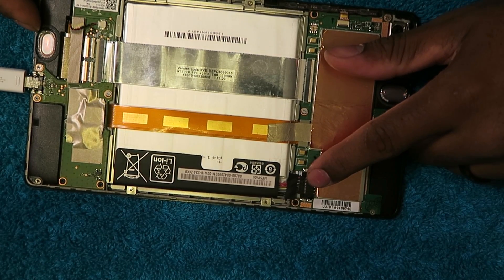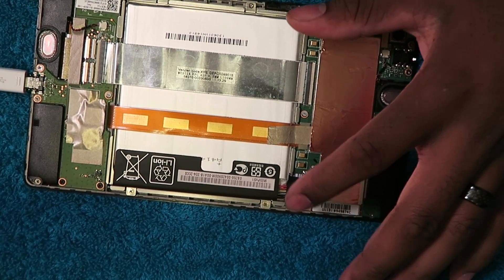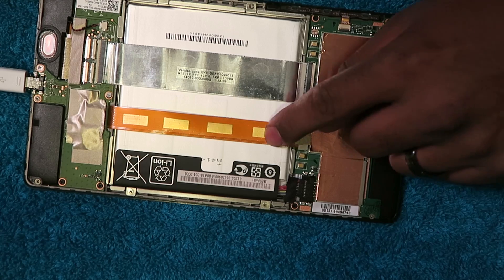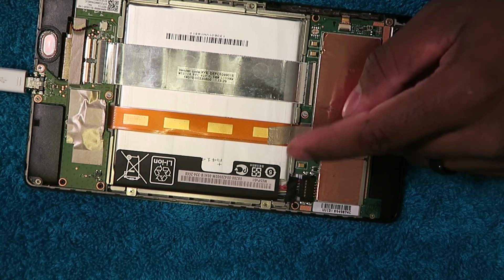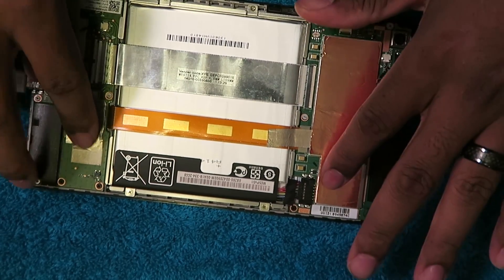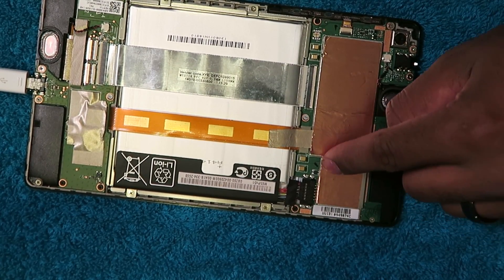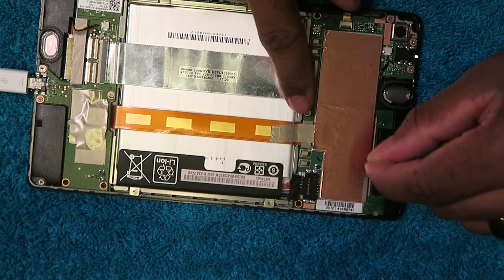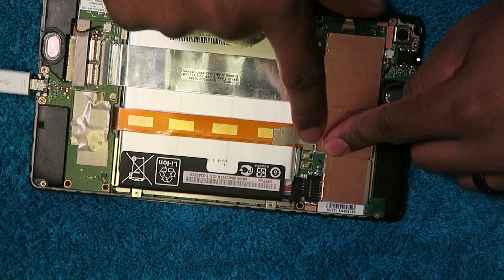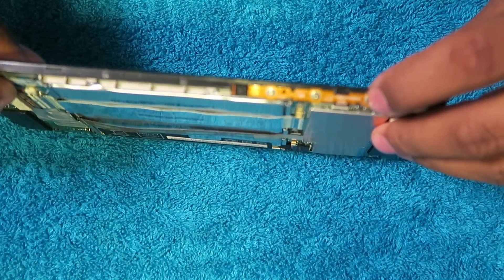After unplugging the battery it wasn't doing anything for me. I unplugged it, waited 30 seconds, waited five minutes, plugged it back in — didn't do anything. Then I got the idea to peel back this little material here and found this ribbon cable — it almost seems like it connects two circuit boards, carrying signals from one side to the other. When I pulled it back, I'm not sure if I unplugged it by pulling it back, but it definitely was not plugged in. When I plugged it back in and held the button down, it started doing the little spin animation.